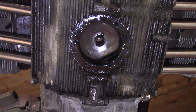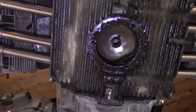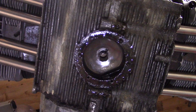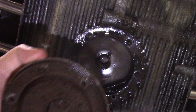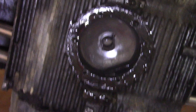When you get into doing your oil change, this is the bottom of the case. You have a strainer that goes up in here and you have what you could call the oil pump cover, oil sump cover, or sump plate, depending on what you want to call it. When you take that off, there are six studs in the case that take little cap nuts. Those get stuck on there because a lot of these haven't had oil changes in years — most people just take the drain plug out and never drop the plate or the strainer. So these cap nuts have sometimes been on there for decades and of course they get seized.